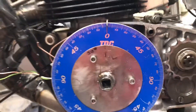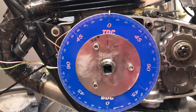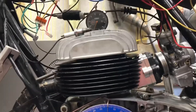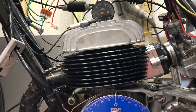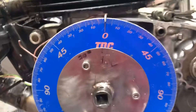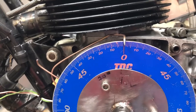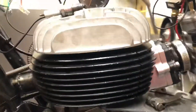The first thing we want to do to get the correct static timing is check to see if our crank angle calculations are correct. We are at TDC — I'm going to rock this so you can see it. There's zero right there, zero here, on the line, zero there. To be statically timed at 30 degrees before top dead center, which is what we want our reluctor to be, it should be 2.12.